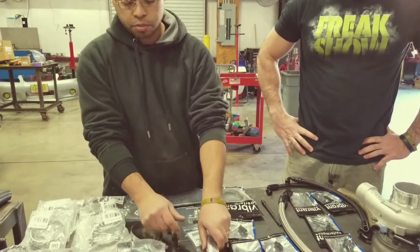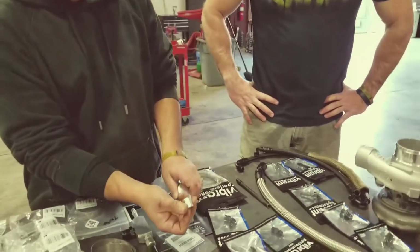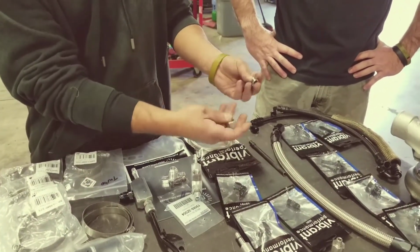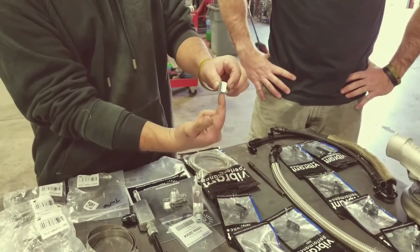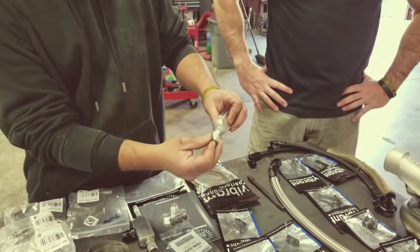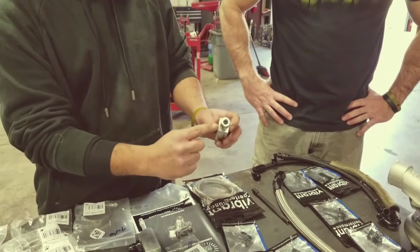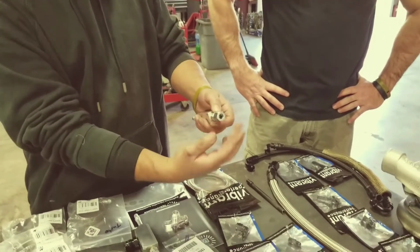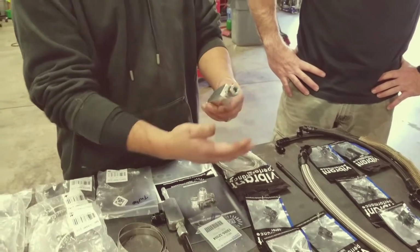You're gonna slide it in this compression fitting. You unscrew this. There'll be a little sleeve in here. Make sure this tapered part is up towards the nut. You just slide the top section of your dipstick in here. Slide the dipstick and the compression fitting up on here. And just tighten it. Hold this, because this is already taped onto the billet. Just hold it with a wrench here and tighten this with another wrench. And just get it snug as you can.